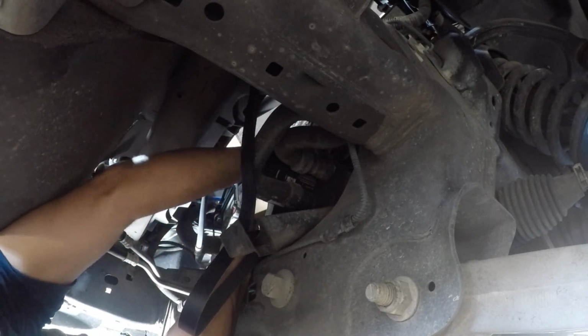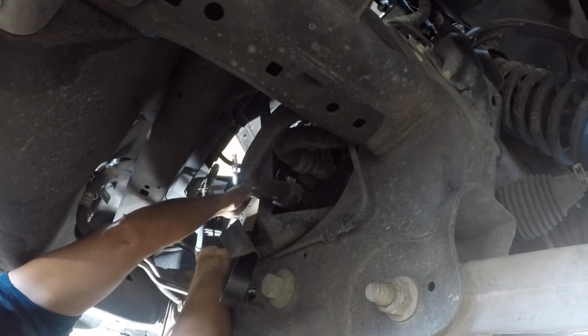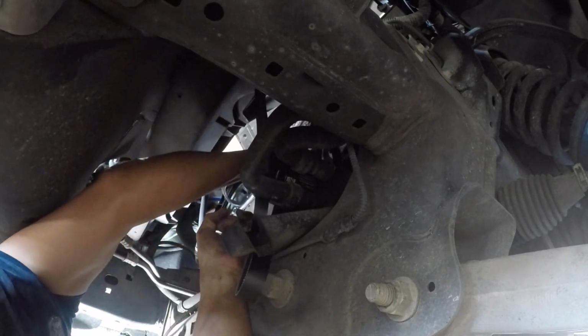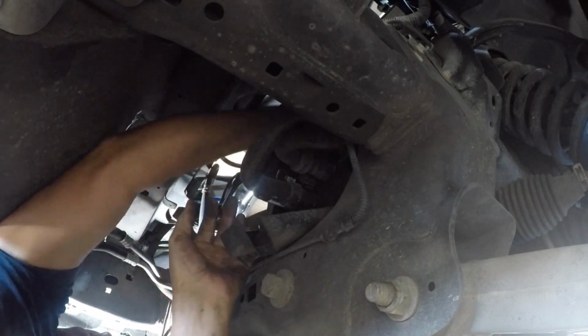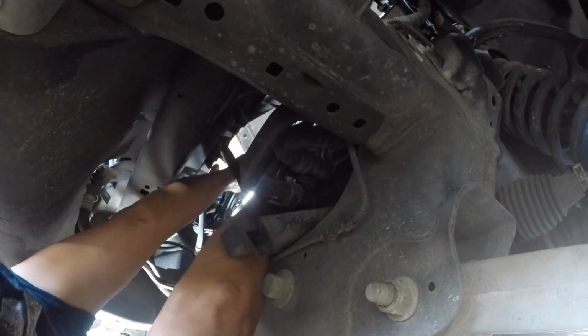So here I'm working the new belt into around where the belt tensioner is at, and down around the air conditioner compressor, and getting it set up around the crank and all of that. And then I'm going to switch back to the top to hook the very top back up once I get there. Would be easier if there were 2 people, someone on top and someone on bottom, but it can be done by 1 person.